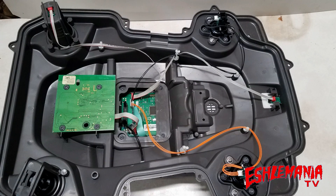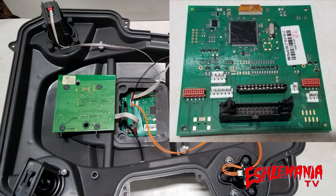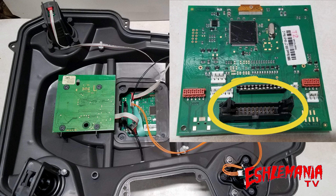The sensors in the upper chassis send all their signals through the HMI board, and then from the HMI board it goes through the ribbon cable down to the main board. The HMI board is in the upper chassis of the Automower and connects to the main board with a large ribbon cable. Here's the upper chassis — we have it off the mower, flipped over — and you can just barely see some of the HMI board. Here's a better view of an HMI board that is out of the mower; this is the back side of it where the large ribbon cable connects to go down to the main board.